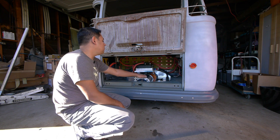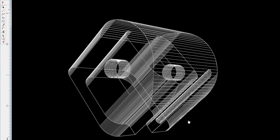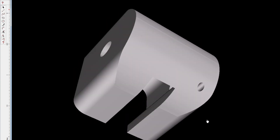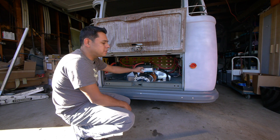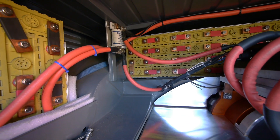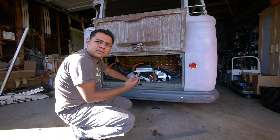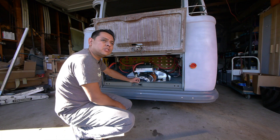My aim is to make it look symmetrical. I'm using a CAD program to design it in 3D, and in a few weeks the parts should be able to come. I'm also designing the parts so that there's some surface for branding — like putting EVTV on there. Another part I'll need to make is some kind of protection for all the batteries. There are a lot of exposed terminals and high-voltage connections — 120 volts exposed in my system — and I need to cover those up so I don't accidentally electrocute myself, and so nobody else gets into trouble if I take this car to a show.